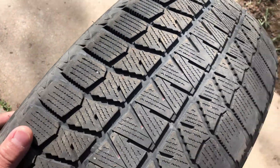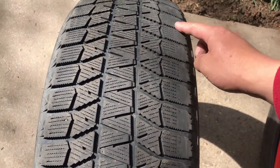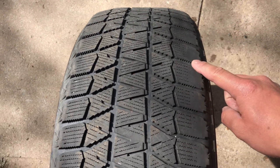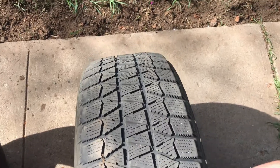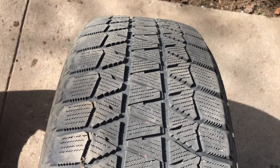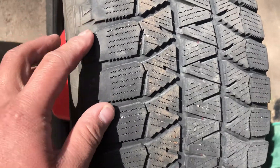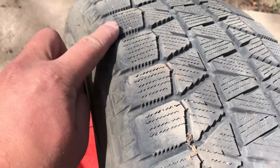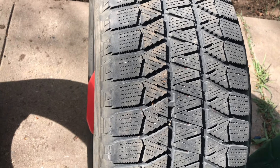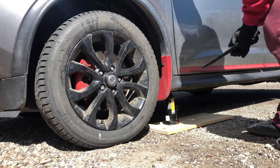On the other side it's still good — that's placed on the front driver's side of the car. That's one indicator that your ball joint is bad and needs to be replaced. On the front passenger side you can see it's still good, it's not balding. Now I see a little bit of balding here, so probably the other lower control arm is going bad as well.